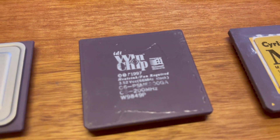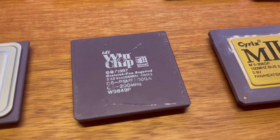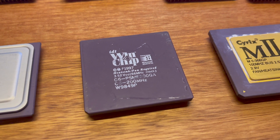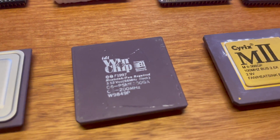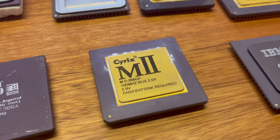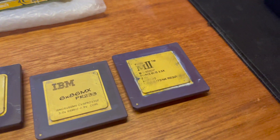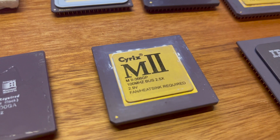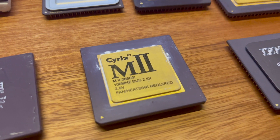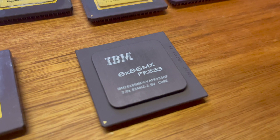This is an interesting one — the Winchip. This is just the first Winchip and it runs at 200 MHz. I'd love to get my hands on a Winchip 2, but I don't have one of those. I don't even know if this Winchip works, but all the pins look good, so I'll be interested to see how that goes. Based on what I've read, it really is more like a 486 and the floating point is terrible, so I think it'll struggle to even match the Pentium 133 in a lot of benchmarks. I also have my fastest Cyrix on Socket 7, running at 250 MHz on a 100 MHz front-side bus, so that'll be interesting. I also have a PR333 in the 83 MHz version as well.